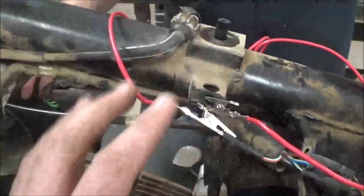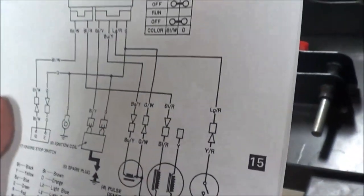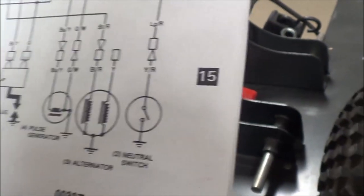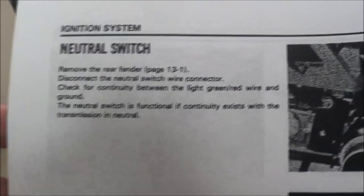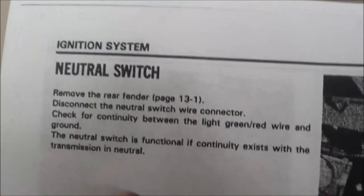The only other tests left were wiring and the CDI box itself. We discovered something else on this vehicle that is also part of the ignition system: the neutral switch. The neutral switch can open and close and goes directly into the CDI box. Even though it doesn't normally affect ignition on most vehicles we're used to working on, flipping through the manual pages there's a section that specifically says to test that switch. It tells us how it should operate but kind of just ends there — it's telling us how to test the individual switch, not necessarily what to do about no spark.